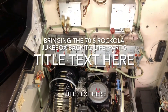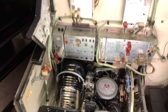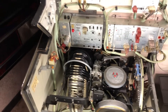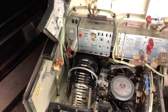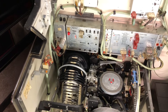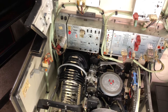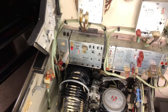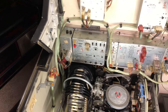Before we go to the troubleshooting final section, I wanted to say one or two more things about the amplifier, since it is the most valuable component of your jukebox. If these fuses on top are good, I should have mentioned there are three other fuses in the capacitor board to check. If they're good and the output driver and heatsink transistors test good and you don't see any other damage to any of the boards, then go ahead and put the capacitors in — your chances are at least eight out of ten you're going to get a working amp.